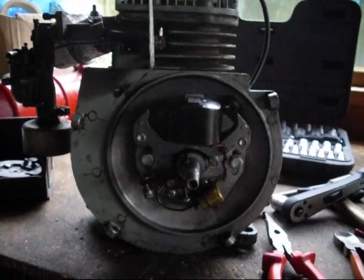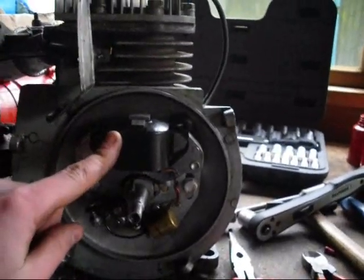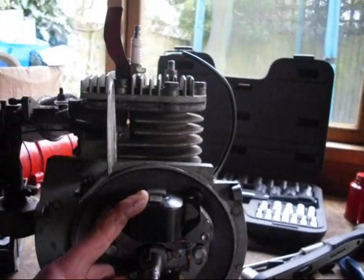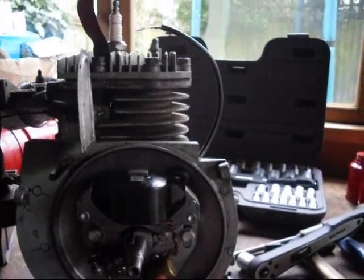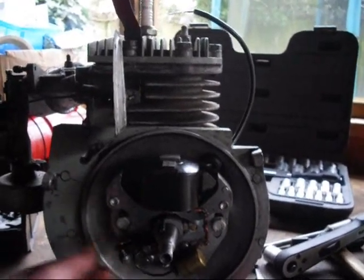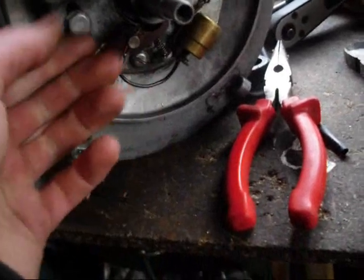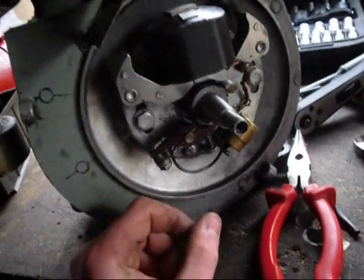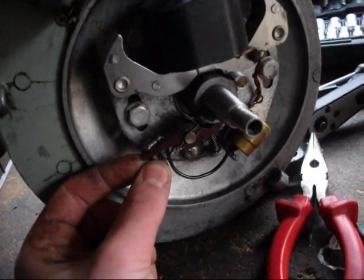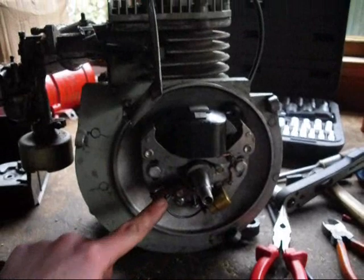So where's the magneto on the engine? I'll tell you a little bit about how these work and point out some of the different parts. This on top here is the coil - there are thousands of little copper windings in there and that takes the voltage up. That's the condenser, which protects the points here and stops them burning out from sparks. The points move in and out - on the shaft there's a cam. So that's the points closed, and when the spark is needed the points break; the spark occurs at the moment the points break. If you're struggling to get one of these engines going, just clean the points and generally they will go.